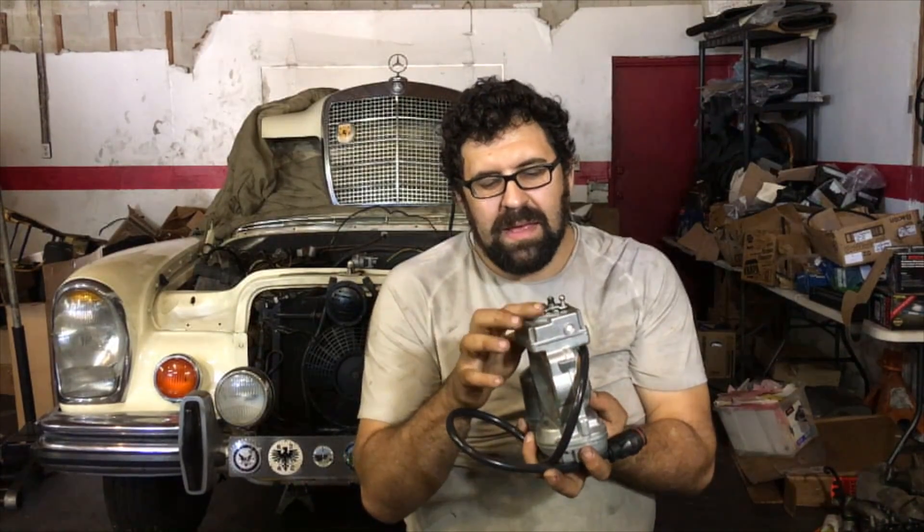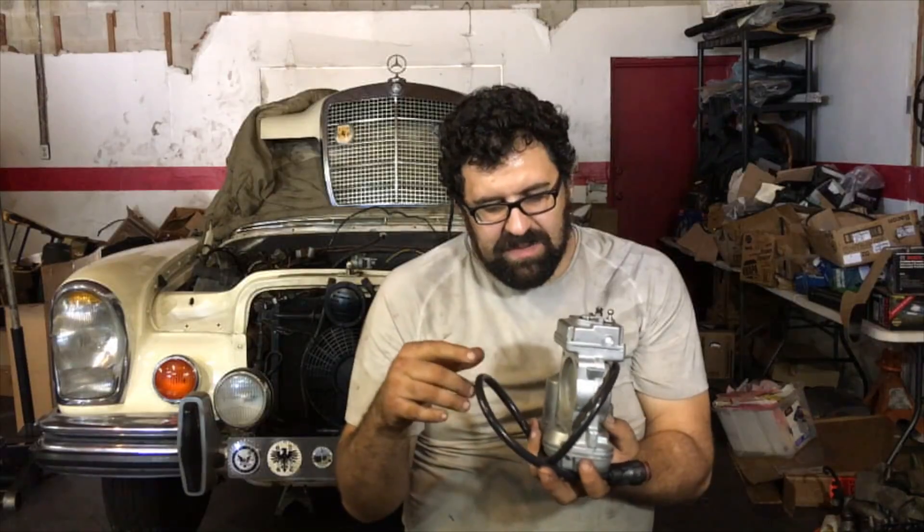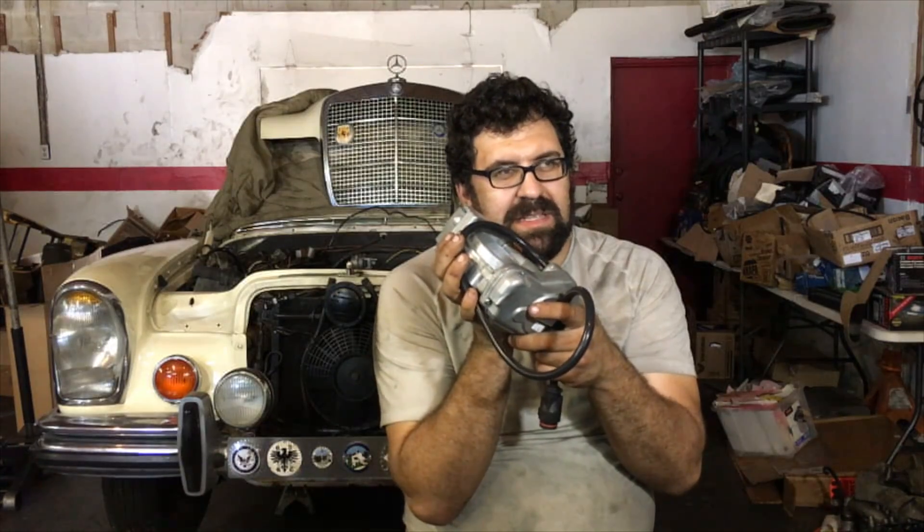...and it also includes damage to the potentiometer inside the throttle actuator. These throttle actuators are actually pretty well made, with the exception of the wiring harness. This one especially — the triple zero one, four one nine four twenty five — which was used on the E420 and E500, and I think also on the SL500, was a pretty crappy part from new. So what Beckman does is they take these throttle actuators, re-engineer them, and take all of the bugs out of them.